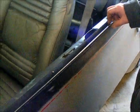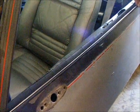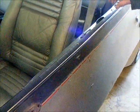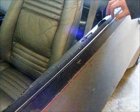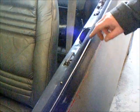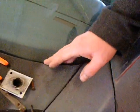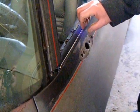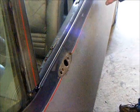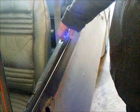In the early 1970s there was a flat chrome bead, which was very flat, and this is a very popular one on the reproductions. However, towards '78 and up it went to a rounded chrome bead, which is now available as a reproduction. And then on cars that had the exterior deluxe molding package, which would have moldings on your fender tips and also on your chrome hood wrap, you'll have a separate unit which is actually held in place by a series of studs across the top of the door. In that case, you would order your window sweeps non-chrome bead.